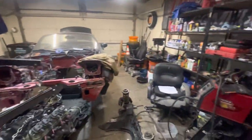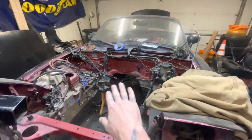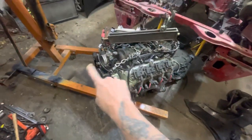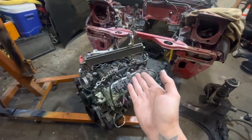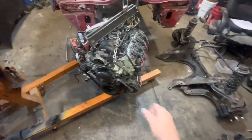Did all this by myself — you can see how awesome my tools are and how much room I have to work with. I'm gonna get this guy up in there, make sure she fits everywhere, then build some motor mounts. I got the high pressure oil pump, new front seals, and another rear main seal because I must have done the steps wrong — it's like a drip a month. Also need a new oil pan gasket since they all interface together.